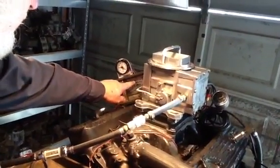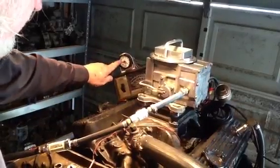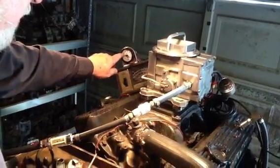Your idle speed is right over here. You can crank it up and down just like you do in the other carb. When we're going to start it up, I want it to be idling about 800. I've already got it preset. I've got this set to get about 12 parts of air to one part of gas.